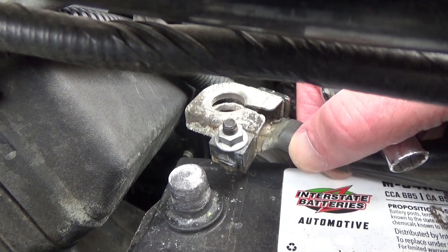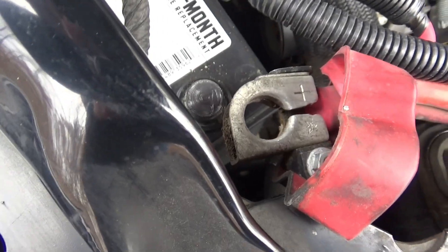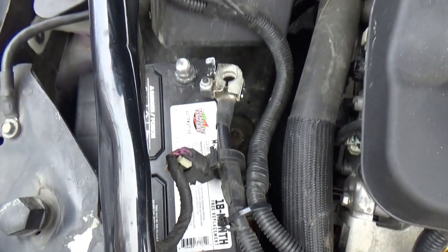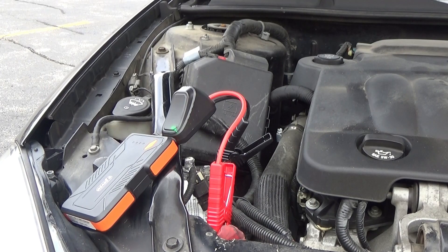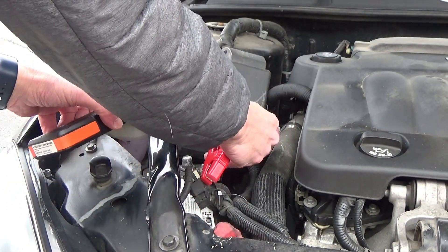I've got the negative cable off — I'm going to move it to the side of the battery, out of the way. And the positive cable is off now. The charger's on, it's flashing green, so now I connect it to the ends of these cables. They're both hooked up. I've got a solid green light. I'm going to go start it... And it started. It worked just like it was supposed to.